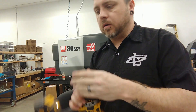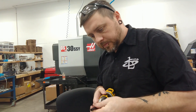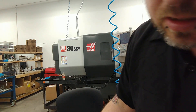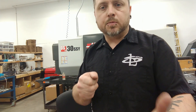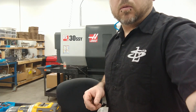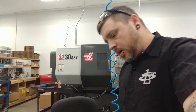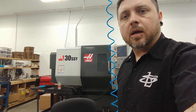I don't think this vacuum line that I'm using is actually silicone — it doesn't stick as good. So I might have to try to go back to the other one and just squeeze it on there. But basically that's all there is to it. We want to just keep some pressure on there and keep spinning it and let that compound just work its way on that seat. Then we'll clean off the seat and you'll be able to visibly tell if it's cut it in well or not.